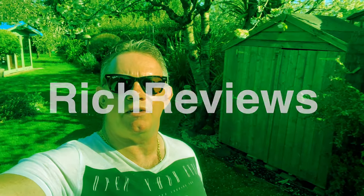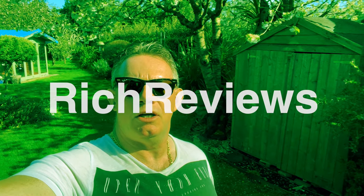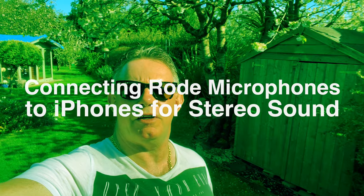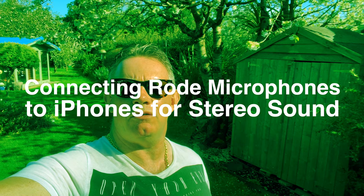The Apple iPhone 10 and above have the ability to record in stereo audio sound. What this means is if you have a single microphone connected to the iPhone, that single channel is distributed across both the left and right stereo channels. You don't actually get true stereo audio because you only have one single audio source, but it is distributed across both channels, giving you a fuller audio sound stage.